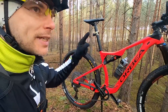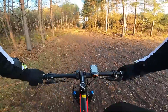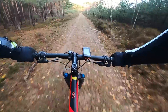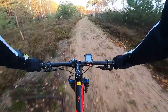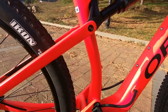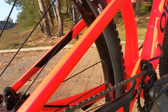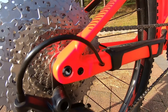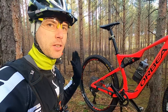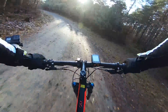We have two versions of these bikes, both in carbon and alloy frames: either 100 millimeters or 120 millimeters of travel. The difference doesn't only lie in those 20 millimeters — it's all about the kinematics and how the suspension works. The 100mm version is more cross-country-oriented, more progressive and supportive — the deeper you go into travel, the stiffer the damper and fork become. The 120mm TR Trail version is more linear and will more easily go further into travel. For me as a cross-country rider, 100mm is great, but many cross-country pro riders are now switching to 120. If you want a versatile bike that is still capable and pretty efficient, the 120 TR version will be great.